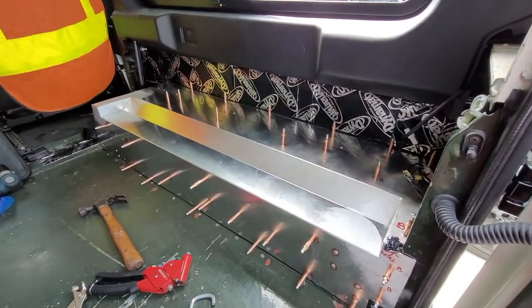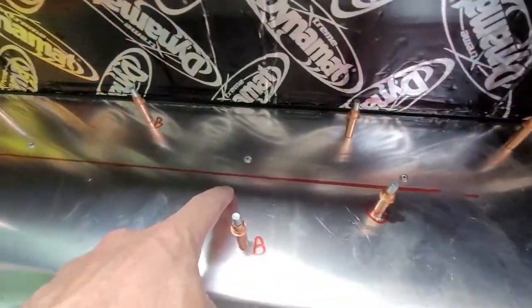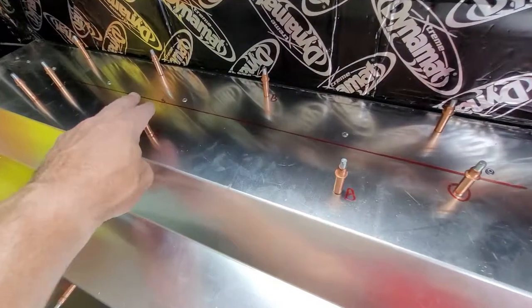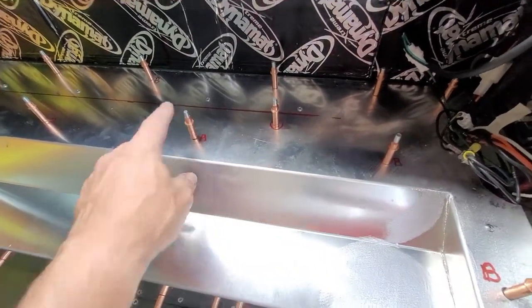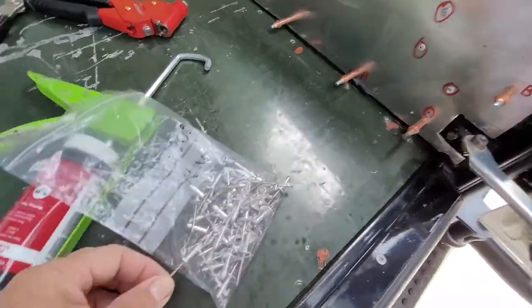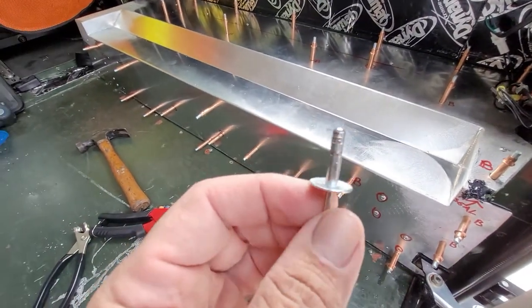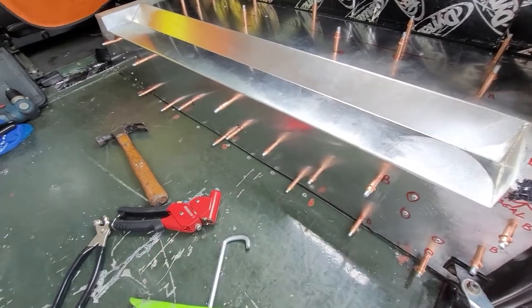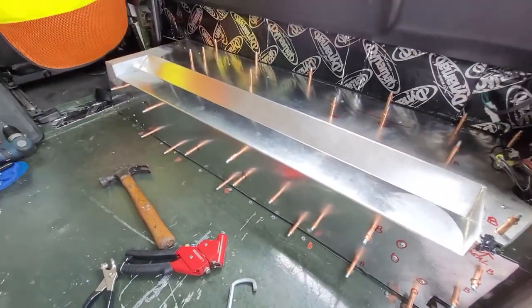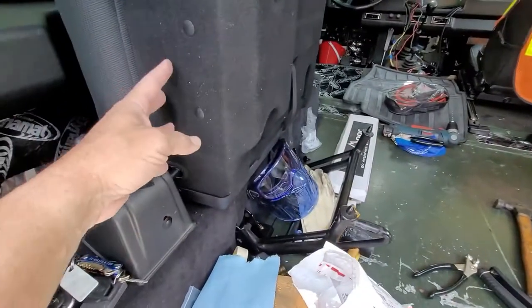This part has been glued in. I went ahead and already put in some of the smaller 5/32 rivets in the areas where I had marked — outside of the area where the bottom piece will be sandwiched in. The ones inside the red line will use the really large rivets, because overall I'm only using 14 of the large rivets to attach the outside panel with this interior panel. I sealed that part. Now I'm just going to let it sit for several hours before I position that piece and make the holes to make sure that the seats are both lined up.